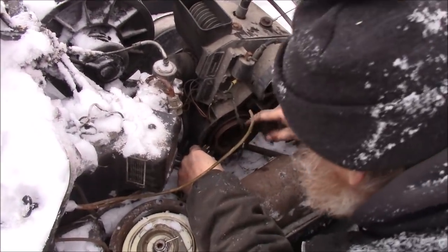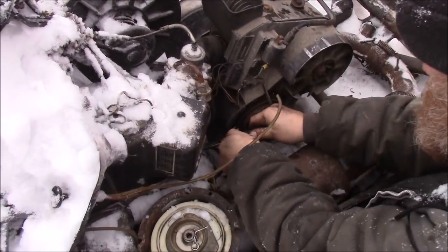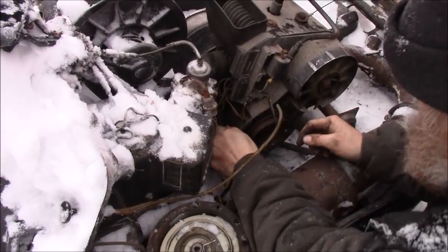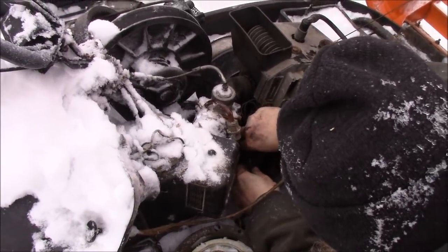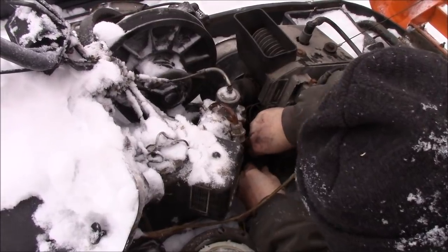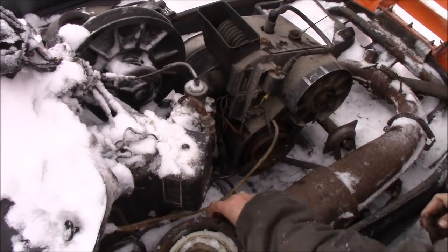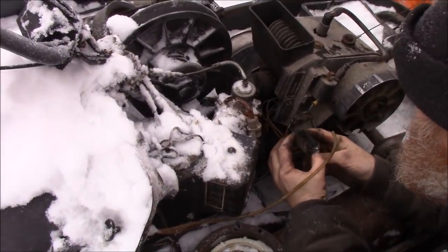Now these get plugged into here. These are the ignition wires. There's the coil wire, which I'm gonna have to tape. I'm gonna have to put a tie strap around them because they will vibrate loose. I'll do up this one here as well. This is the other CDI box wires, the capacitive discharge ignition. That wire is good. Yeah, that ground's good, okay.